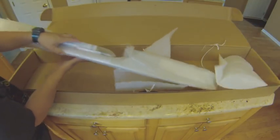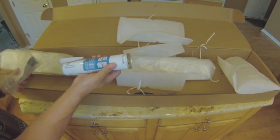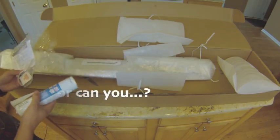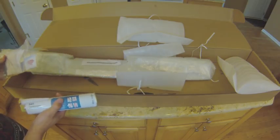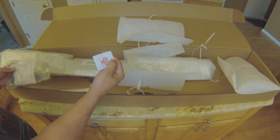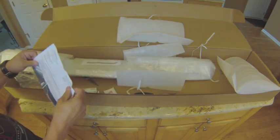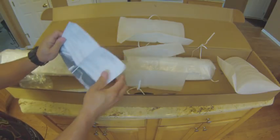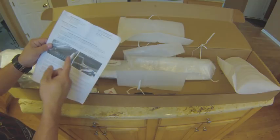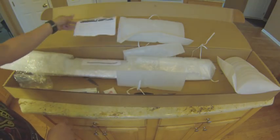That's a decently heavy wing. The first thing you're going to see in the box is polyurethane sealant. You can't just double-stick this wing onto the corner of your cab and expect everything to stay down through car washes and driving. Part of the install requires polyurethane sealant. Also included is an isopropyl wipe and the instructions, which are also available online. It's very clean cut — you're just measuring, making sure everything lines up on the cab, removing the double-stick tape backing, throwing a bead of urethane sealant on it, and slapping it on your truck. As long as you take your time with measurements, it's easy.